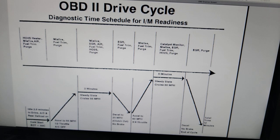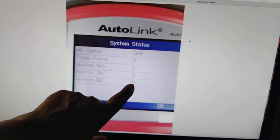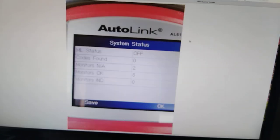Just so you know — if you live in a cold climate, the drive cycle might be enough to clear everything on the first or second try. But if you live in a hot climate like Phoenix where it's 110 to 112 degrees every day and only cools to 90 or 95 at night, you need to get somewhere cooler and let the engine get really cold. That's what I did and it worked. When I was done, the scanner showed eight monitors complete and zero incomplete. If you live in a hot climate, that's the way to get your evap and secondary air system monitors to show ready.